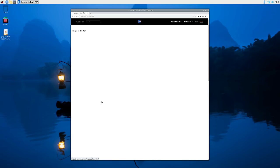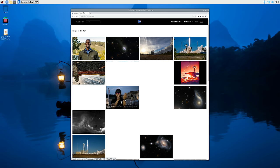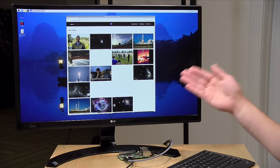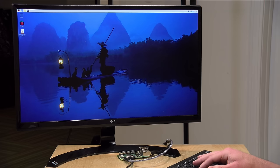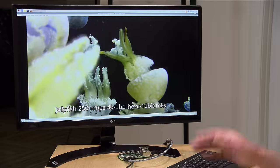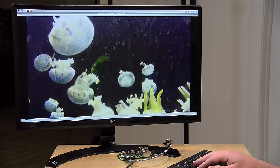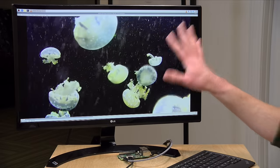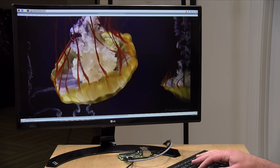It's still not quite where it needs to be as a 4K PC even though it can output at that resolution. Loading a 4K test video in VLC, it actually plays back just fine provided you don't pull down any menus. This is an HEVC 10-bit file running at 250 megabits per second at 4K, so the HEVC decoding seems to work okay — but again, a lot of what you'll experience at higher resolution is a bit sluggish.